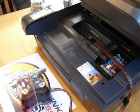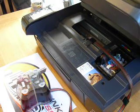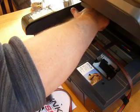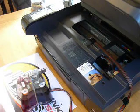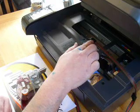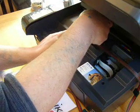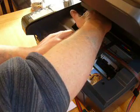What we need to do now is to manually slide the printhead all the way over to the left hand side and to the right hand side, and just make sure nothing is snagging and nothing is catching at all. Manually push the cartridge block over to the left hand side, then manually slide it back to the right hand side. What you're looking for is no snagging or twisting — it should run freely. These ink lines can be adjusted through the tube clamp: if it's too tight you can pull it to take some of the slack away, or push it the other way to give more slack to reach the left hand side. That shape you see is quite normal.